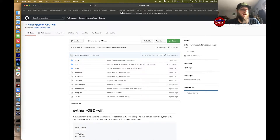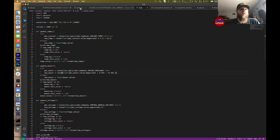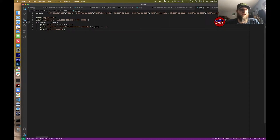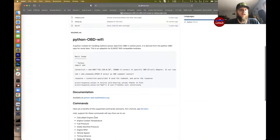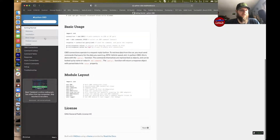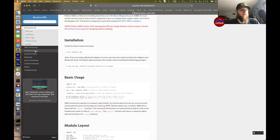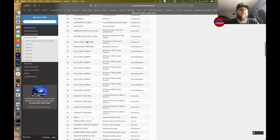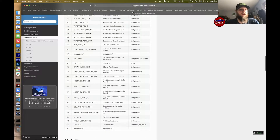I used this GitHub repo — the Python OBD WiFi — to actually do some of the Python code, and I'll leave a link down in the description. I wrote a couple of different scripts. The first script was this little generate script, and I used it to generate code so that I could get all of the sensors supported by the system. Looking at the actual docs for that project, we can see the basic usage, all the various different commands, and the actual command table — here are all the various different commands that the library supports using that ELM327 adapter.